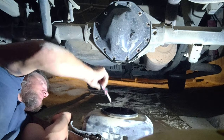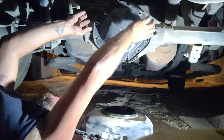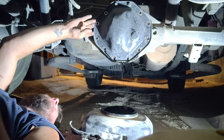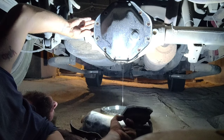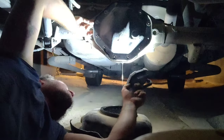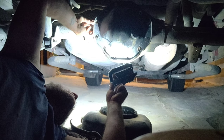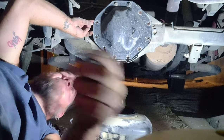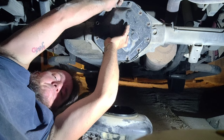The gears are still there. That besides the drip dry - man, that is dark. Always take your light and get close so you can see the color of the oil. Never want any metal in it. I'm not happy with what I'm seeing in this oil - I'm seeing a hint of brass. Great.